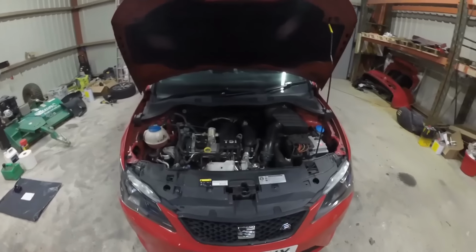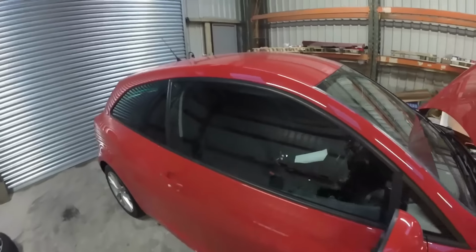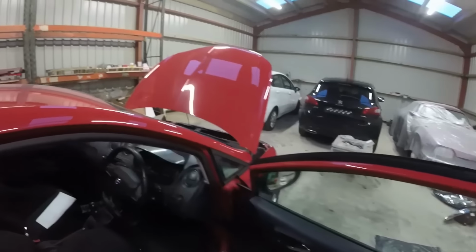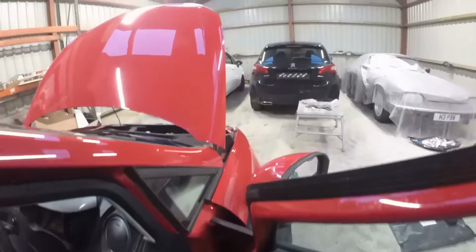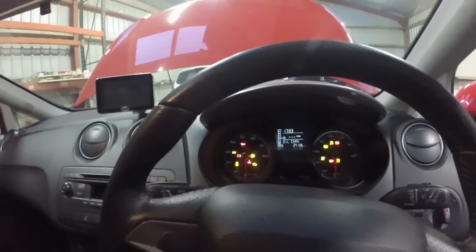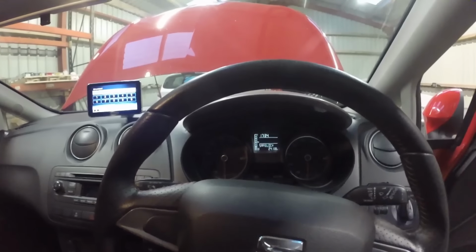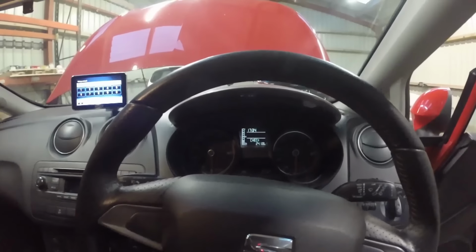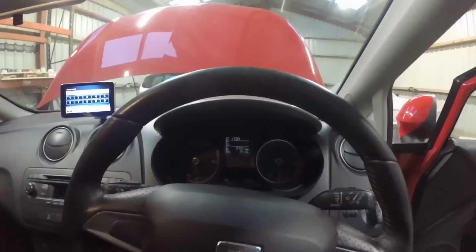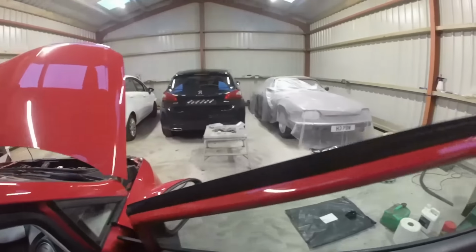As I just mentioned, these actuators need to be calibrated when they're installed, and I didn't know that. There's an easy way to calibrate these without any kind of programmer's computer. All you do is get in the car, get your key, and turn on the ignition 5 seconds, turn off the ignition 5 seconds, and repeat that 15 times. That's what I found on Google, and in all fairness, it worked. Since doing that, I've had zero codes.